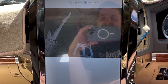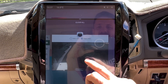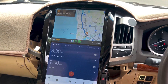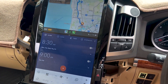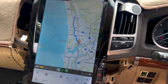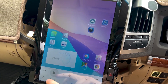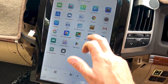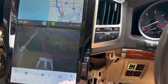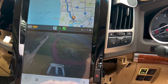You'll be able to view the caravan camera while driving along, and you can even have it as a split screen — caravan camera at the bottom with music or other content. When you jump in the car with CarPlay coming up, if you don't have split screen already, it would have popped up to CarPlay or Android Auto. Click and hold, select cam. If you don't have cam open, click home and find it in your apps. Click that and you'll see your caravan camera up as a rear-view while driving.